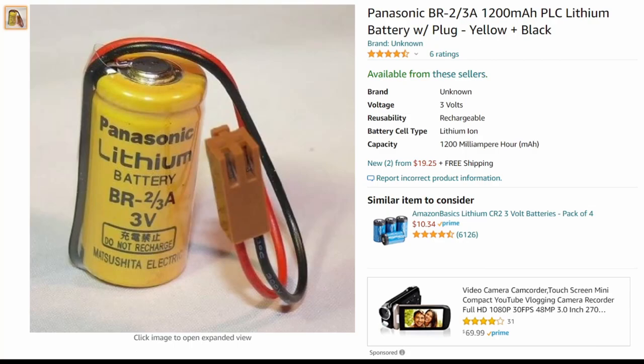And it's also important to note that if you get the lithium batteries without any solder tabs attached to them, where those tabs are clipped in on the battery when it's manufactured, the manufacturer's not soldering anything to the battery leads. And that's an important point here. You don't want to solder to a lithium battery. If you get it heated up, as you have to get that solder to bond to that surface, you can cause the battery to explode. So this is fair warning that you do any sort of that modification at your own risk. My disclaimer in this video.